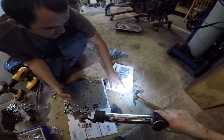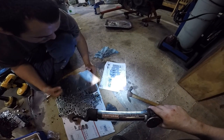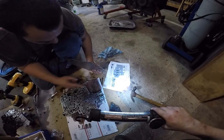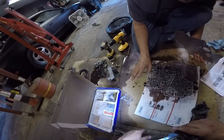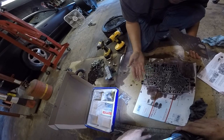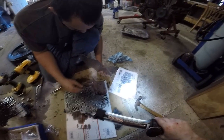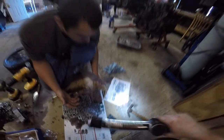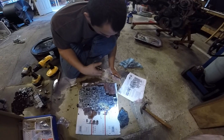Now, on Troy's two dump trucks that I worked on, I did, what, like 100? I think I did the 0.96. But on the blue springs, I think I just used the bigger spring of the two. Because I figured the 4,500 dump truck probably needs a little bit extra firmer shifts. And it actually was very calm. Huh. Because of all the weight, maybe. I was actually very surprised.